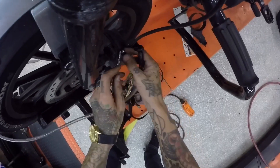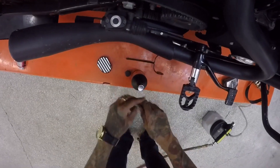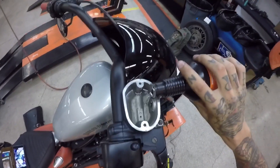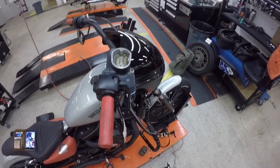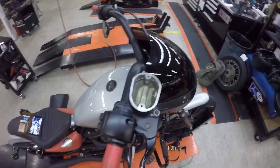It is an eight millimeter on the sport series — remember that. Would help to get my brake fluid, guys — there it is. Sorry guys, I've had a long morning. Kiddo woke me up early. So we're gonna go ahead and open that and pour it in. This is a much different color than the fluid I had in there. What I do is I will fill her up, and then I'll bleed her out about twice. Your line isn't very long, so after two times your fluid is pretty much changed. What I'm gonna do is I'm gonna walk around and stick this on here.